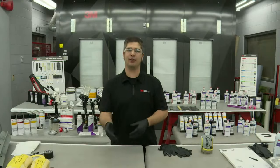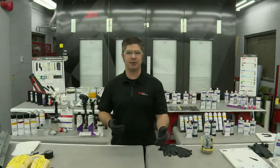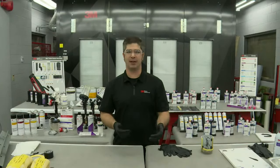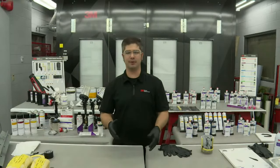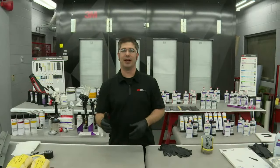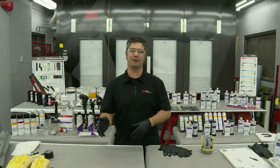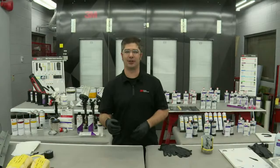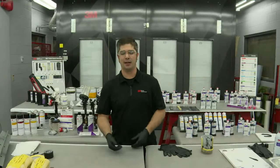We're not allowing any additional new moisture or air to work its way into that surface and continue to oxidize. So yes, if there's corrosion in there, Jason, as an example, I drive a Dodge Durango. I bought it 2 years old, and the first thing I did with 35,000 miles on it was put 7 cans of cavity wax in that truck. A little overboard, probably could have gotten away with 5, but I like going overboard with just about everything I do. I made sure that I had that thing completely filled. I put it up on a lift about a month ago, climbed under and around it and inspected it, and there isn't anything going on underneath there. I'm very happy about that.